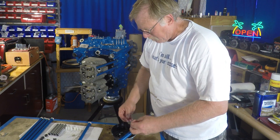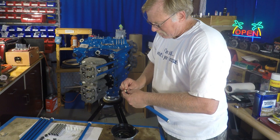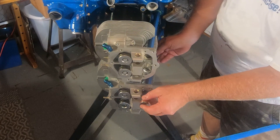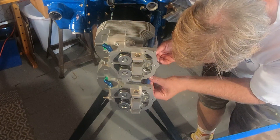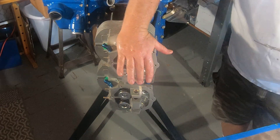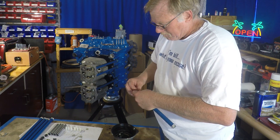I'm only doing one side of the engine since the other side is exactly the same — we're doing two cylinders at a time. It's fairly simple; most importantly, take your time. Make sure everything's right and make sure your O-rings are seated. This is very important on a Lycoming engine, and even more important on a Continental because they're easier to get pinched, especially on the big six Continental.